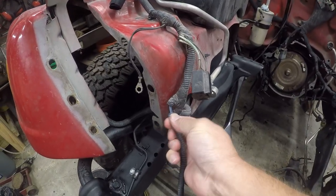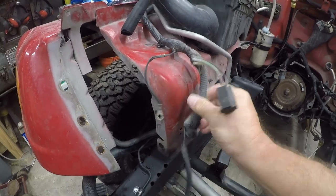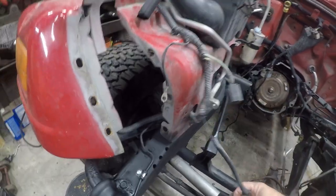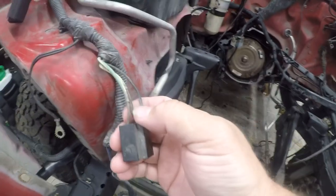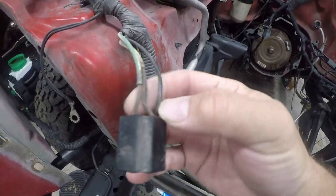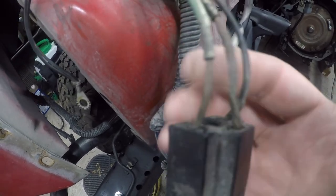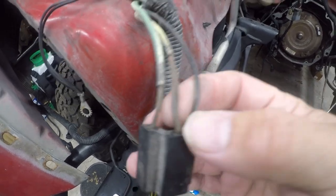So what we've got going on is that this is just fried. This piece isn't too bad, but a lot of this wire split loom is just absolutely trashed. In some cases you can see we've got exposed conductors — this is bad news. You do not want exposed conductors like this; that's where shorts happen and fires start.